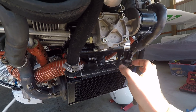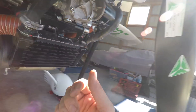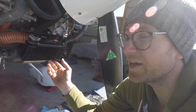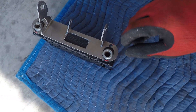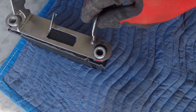If that doesn't work, I'll trim inside there to slide this end a little bit forward — I just need a couple millimeters and then we'll be good to go. So I notched out the mount for the oil cooler with a round file. You can see the movement I have now — I can move it forward and have more room, hopefully enough to install the new oil lines.